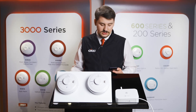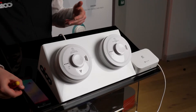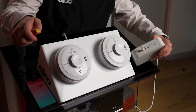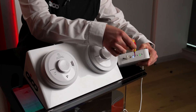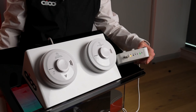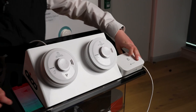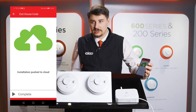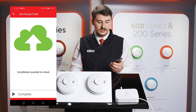As this is the last product within the system, press finish this time rather than add unit. It will then ask you to press the house code button on the gateway until the light goes solid blue, then release. The yellow GSM light will then come on as the gateway uploads the profile to the cloud. When it's done, press next and you should get a green cloud symbol to confirm. Press complete when done.